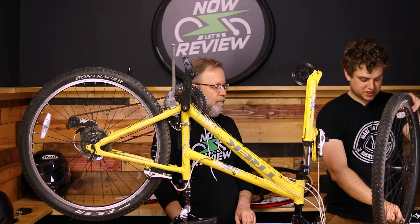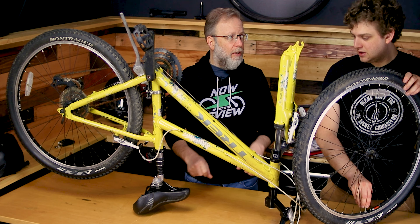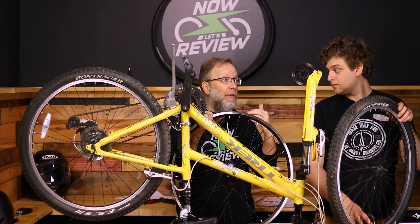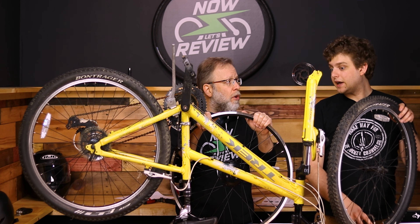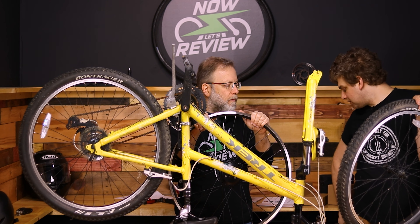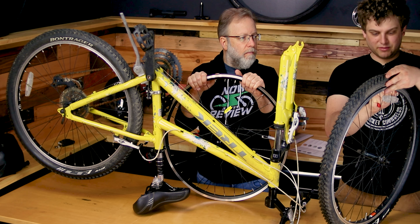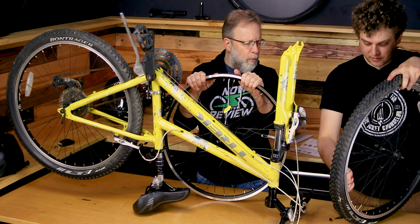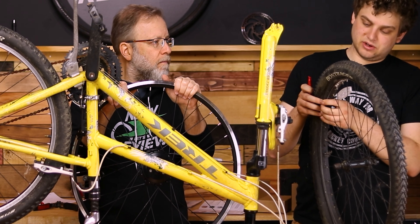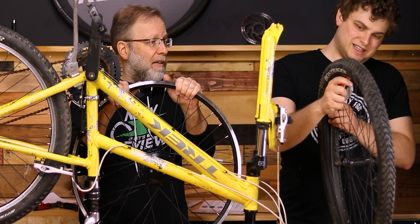This wheel itself won't be used, but we can reuse the tire — so that they'll match. First step is to let all the air out of the tire. At this point, if the bike has been sitting for years, it would be good to maybe replace the tube and replace the tires. This is a 250 watt 36 volt motor from Switch. It'd be interesting because we haven't, that I know of, had an electric bike with a motor on the front. This will be our first bicycle with a motor on the front. Typically motor on the back is nicer for acceleration — front wheel drive tends to slip if too powerful — but at 250 watts we're not going to run into that issue.